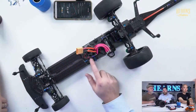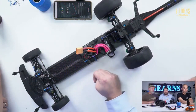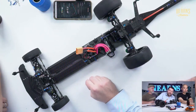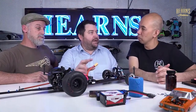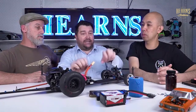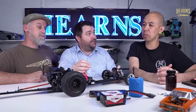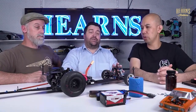It's got the same software and tuning factors as the OE 1 but beefed up about 50%. I'm running the factory setup and it all works great. I'm running a switch too - when you've got the body on and everything, it's a lot of pain plugging batteries in and out. I use XT90 plugs. There's one above that called a QS8 which is an 8mm plug, but personally it's too much - I can't pull them apart. I'd actually rather run a 6.5mm bullet, but the XT90 is easy and safe.